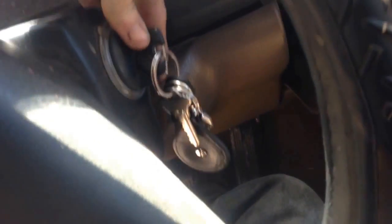Now, your seat belts are only unlocked with the key turned. Because basically the blue one is a remote wire, kind of like if you install a stereo. Okay, so right now to show you that it worked, the seatbelt is locked. Now, if I turn the key, make sure no wires are touching anything. I shorted out my battery last time. And instantly, it'll unlock. But if I turn the key back off, it'll lock again. Oh, nope, my key's still on. There you go. It'll lock again.